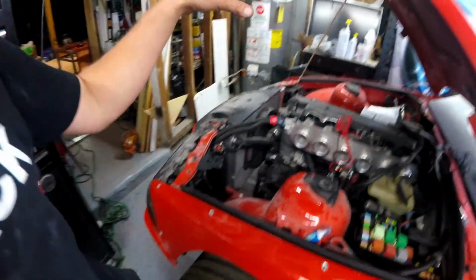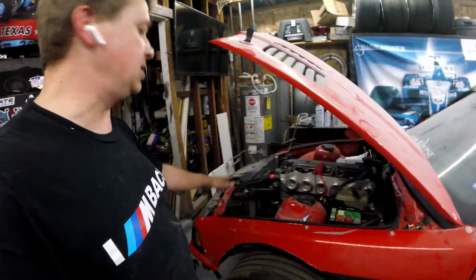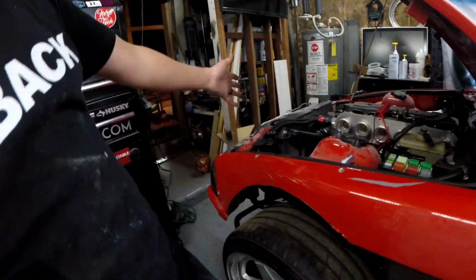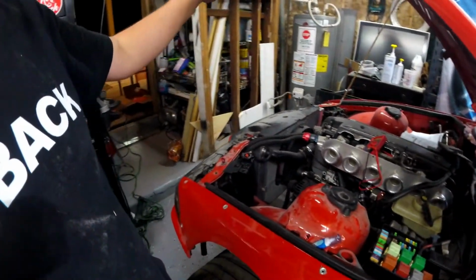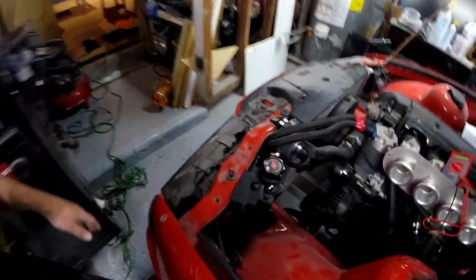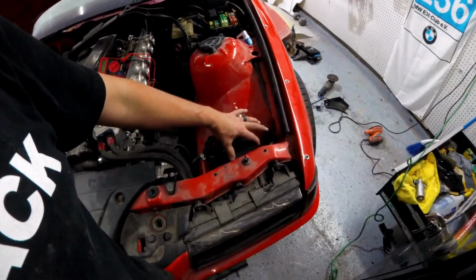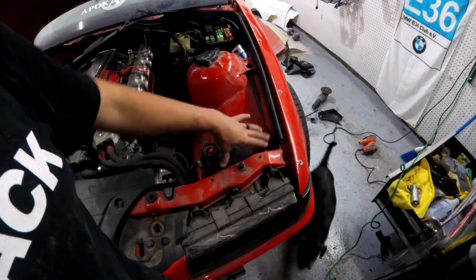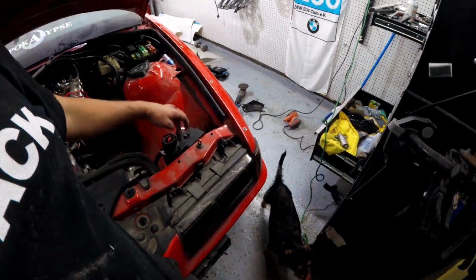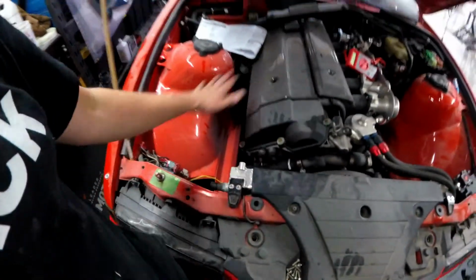Cool little setup. It's gonna allow us to tuck the coolant hose down and behind, and so you will not see the hose as it comes down, and it'll come up and in underneath where all our power steering stuff is. So this is going to be our new location for our expansion tank. So all I need to do is I'm going to fab up a bracket that will go from here, most likely underneath this, to hold that all together. Most likely that'll be some sort of carbon fiber bracket piece that I'll make right there, and then that frees up this whole side for absolutely nothing.